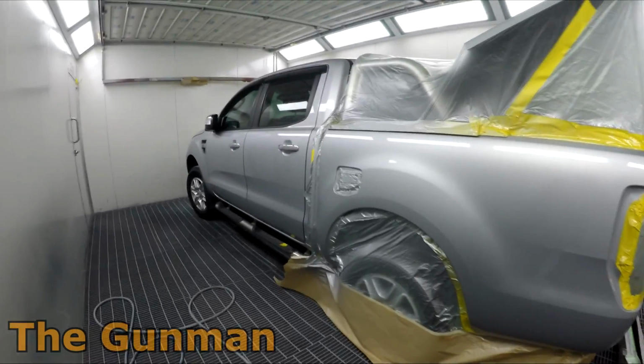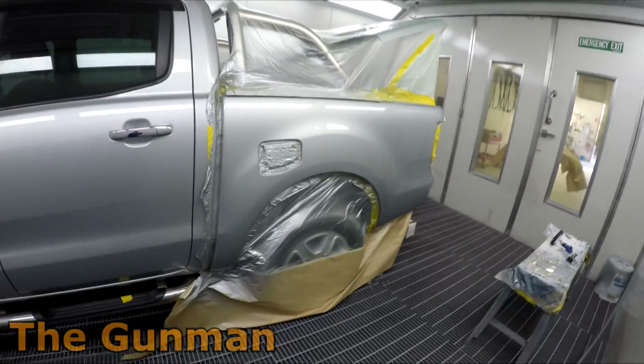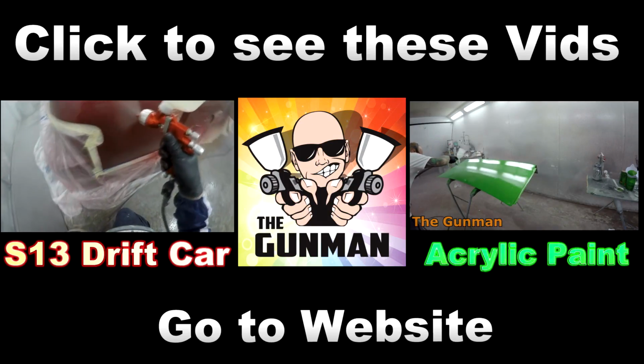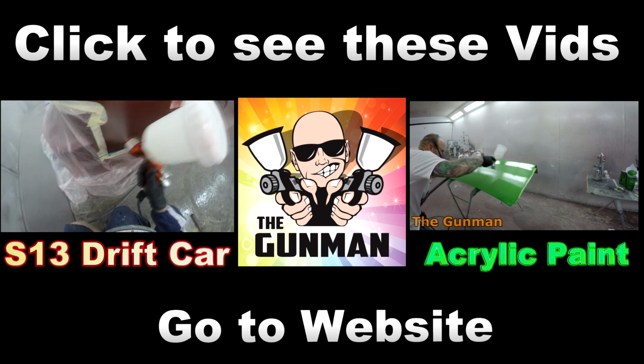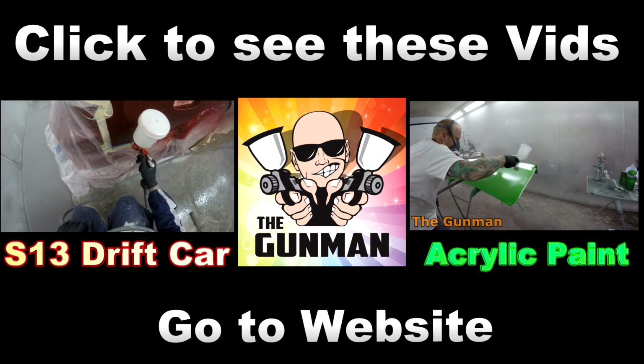I just had a guy tell me that he's gone and ruined a job. Just painted a bumper bar and masked over a wet car, came in the next day, and he's got these sweat marks all over his paint. He tried polishing it up, it looked okay, then a week later you could see all those marks come back.